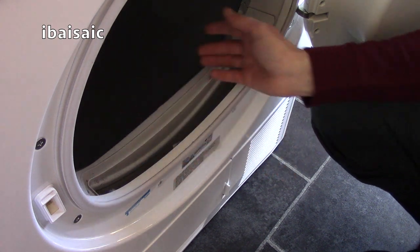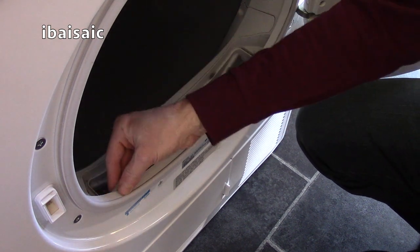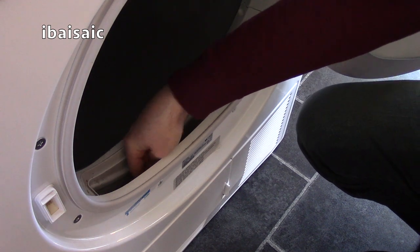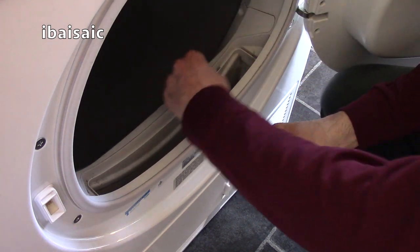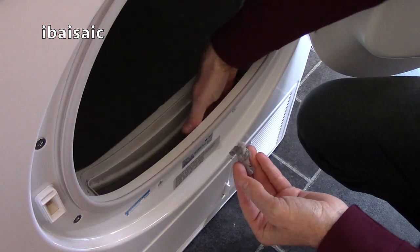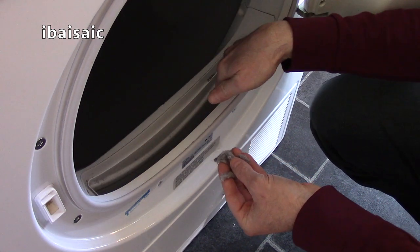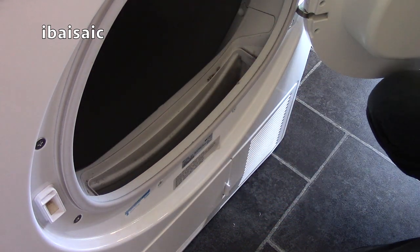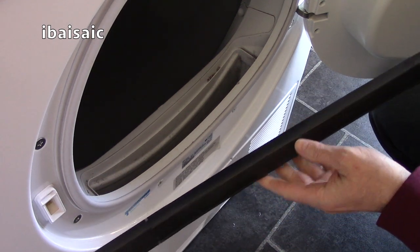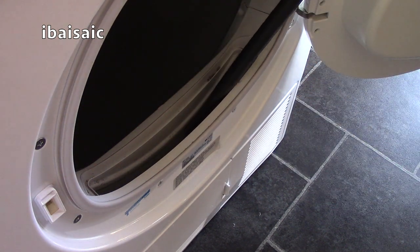When you remove the filter, you might find a lot of fluff and lint that's gathered around where the filter is situated in the machine. You can get your hand in there, but I would suggest you unplug the machine before you start putting your hand inside anywhere of an electrical appliance, just to be safe. I'm not going to be able to get my hand right down there. A tip you can use: those radiator brushes you can buy are very useful for getting down here. But what I like to use is a vacuum cleaner — I bought an extra long crevice tool, so it'll go right down into the groove and hopefully remove all the fluff and lint.